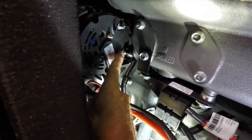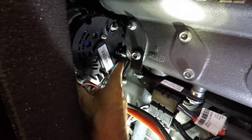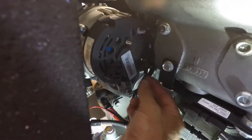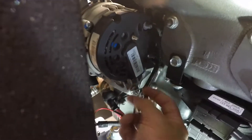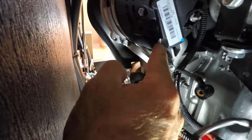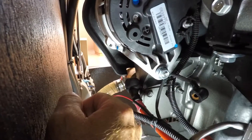I've got this other wire which I think is the field wire from the alternator, so I've got to take that nut off and remove it. The nut is off the field wire connection and it just pops right off. There's one more nut down here — like the one up top — that I've got to spin off to pull the whole cover off.